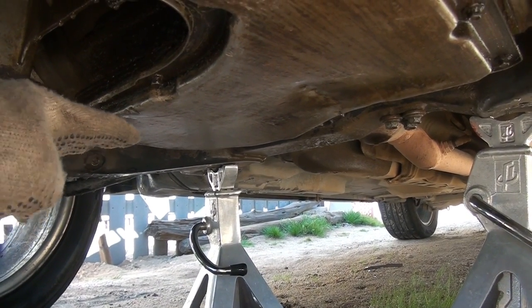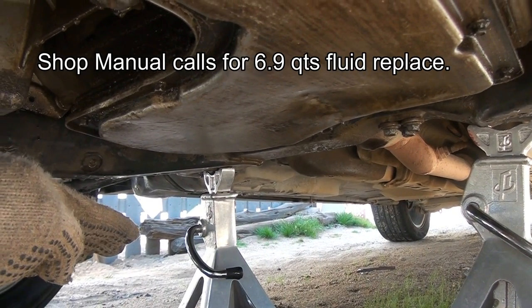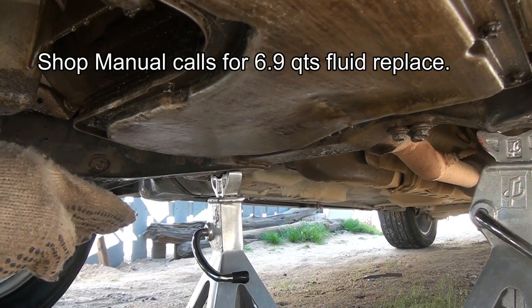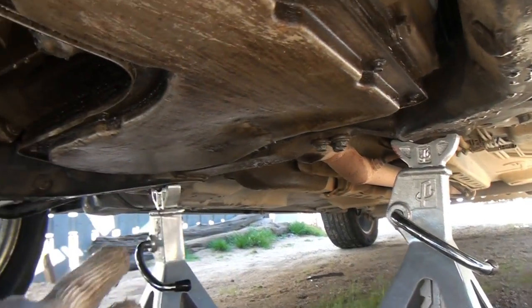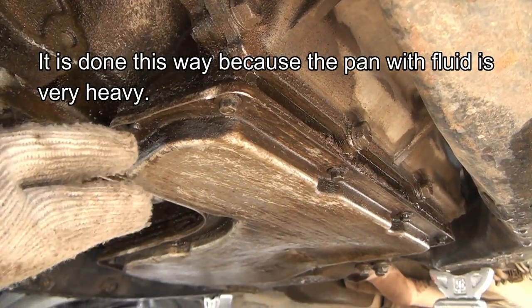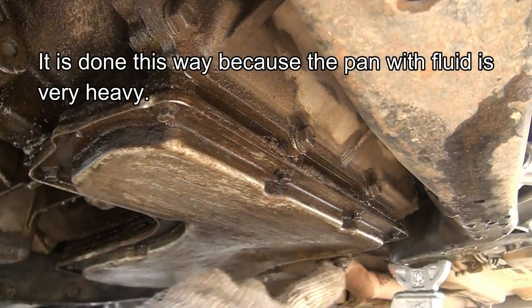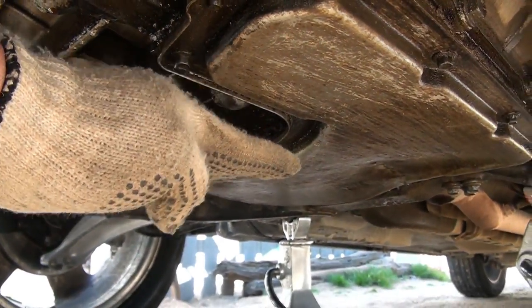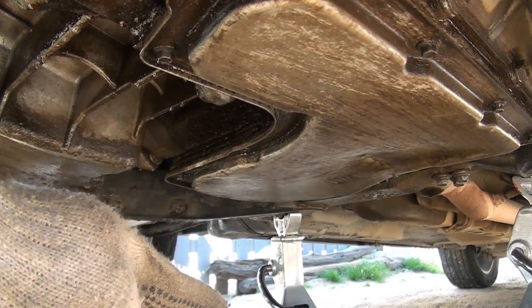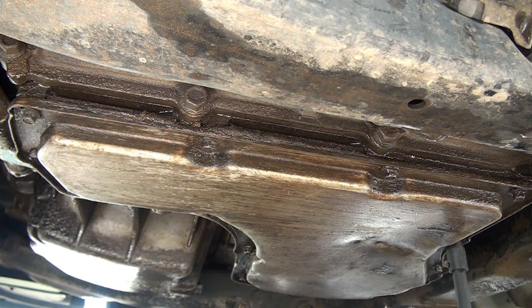The idea is to let the pan tilt down because this one holds almost seven quarts — I think it's 6.9 quarts of transmission fluid. I'm going to take the screws out around here, then loosen the screws around the top slowly, which will allow the pan to tilt down in the front and empty into the drain pan I have here. I found that a 5/16th socket works better than the 8 millimeter.